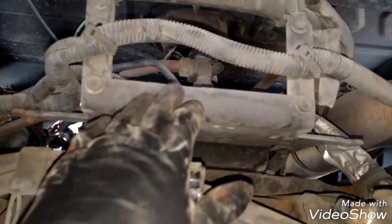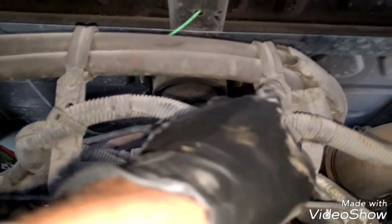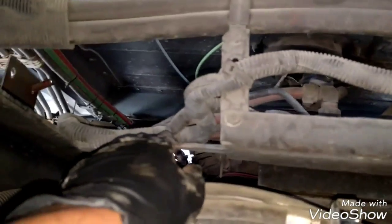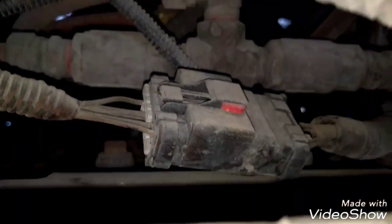Now we're going to remove this plate completely so I can make some room to work in the top area of the transmission. We're going to disconnect all the clamps, the wires, the cables that are connected to it, and all other stuff connected to it. Then we have to remove those bolts — there are 2 nuts, 15 and 16mm. It's very hard to see them, there is one here and there is another one right here, so we can remove the plate completely.